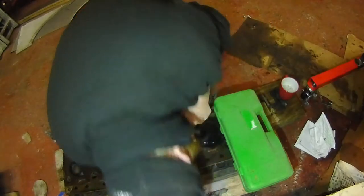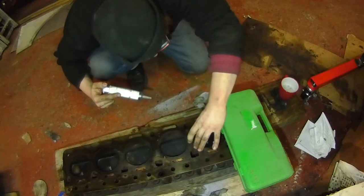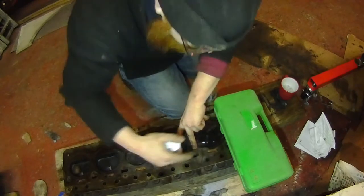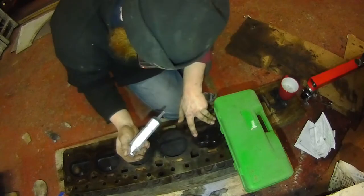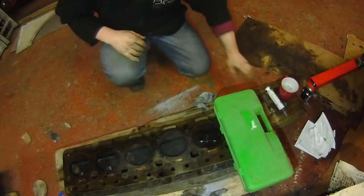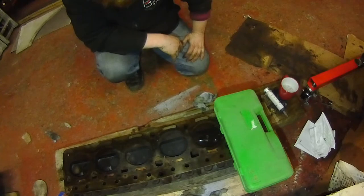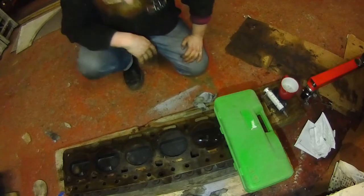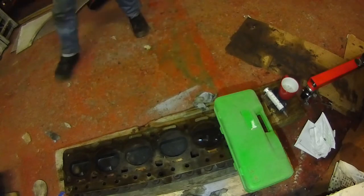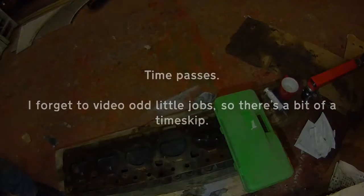Looks like we're gonna leak somewhere. Oh yeah. Yeah, I'm gonna say that is about 120 cc's in the head. Roughly. Even though it's gently leaking out of that side. So we're gonna go with a rough guess of 120 cc chambered in the head.